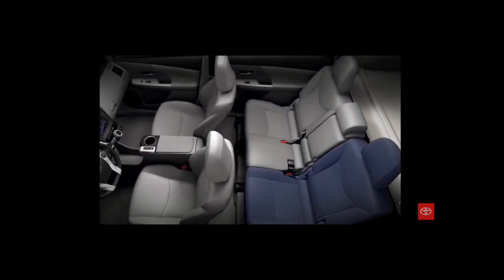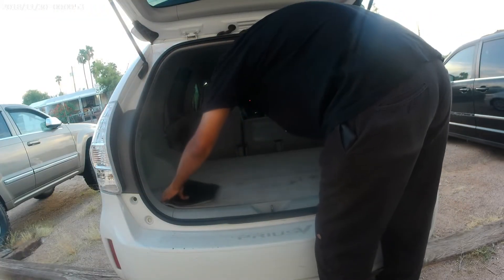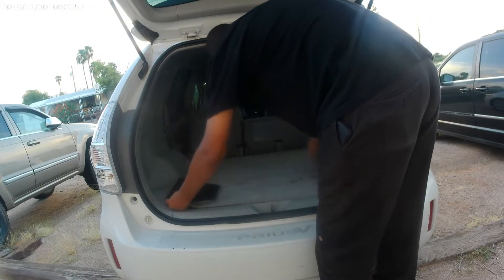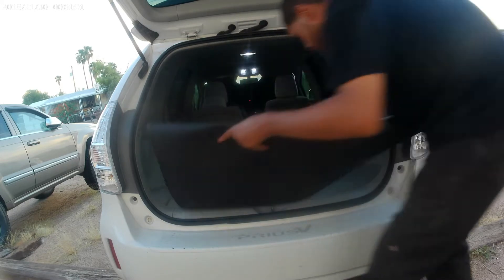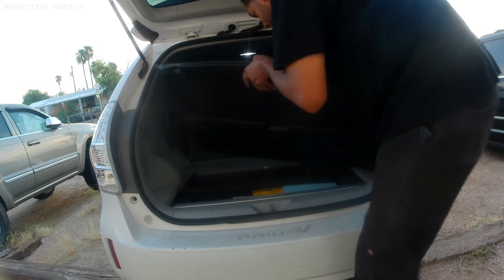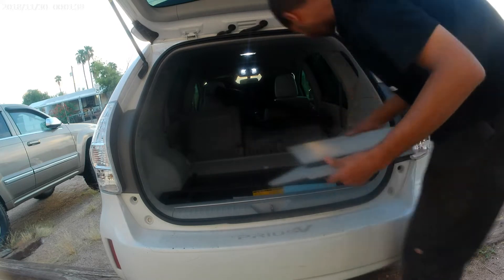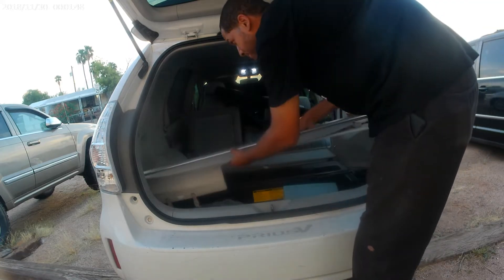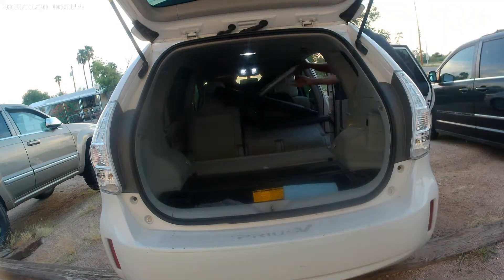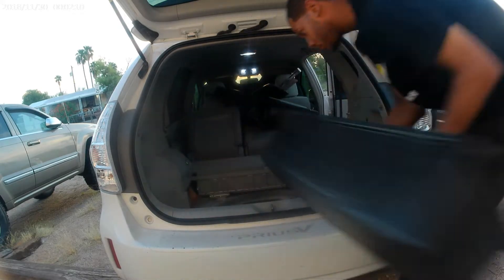This is my personal 2013 Prius V. Disassembling the rear of the Prius V is pretty easy. Start out with the carpet if you have it so equipped, and take out the main plastic top cover, the two side covers, and of course the little privacy shade. Then remove the bins and you'll see the back end of the battery.